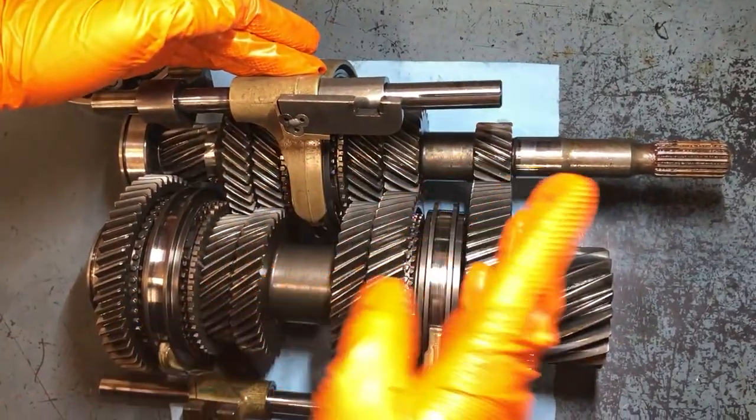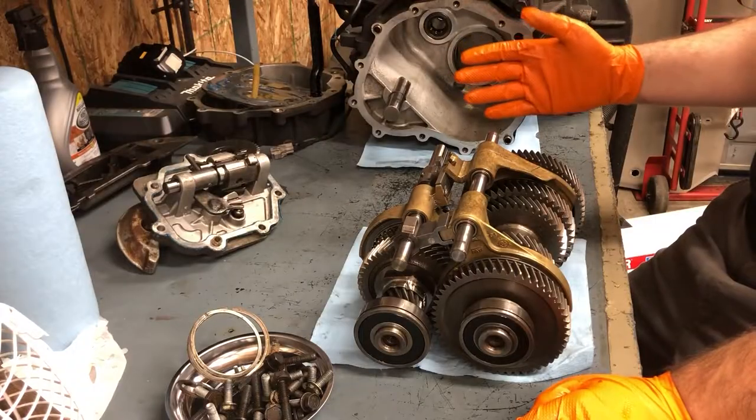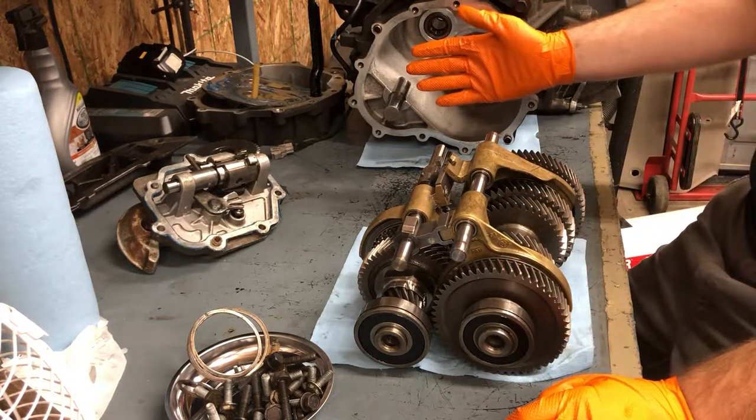I think what was going on is sometimes, because this could move from vibrations, sometimes it was there and would work just fine, and other times it would graze right off the top. I know these are prone to crack — that's why this one had been replaced. If you're having a similar issue, these can crack and eventually snap right off, and you won't have a third gear at all. So if you want to pull your gear set out and see what's going on, it's pretty simple to get there.